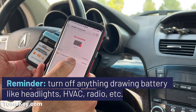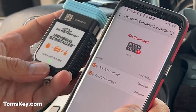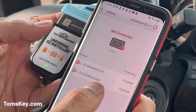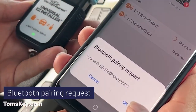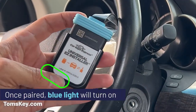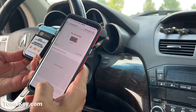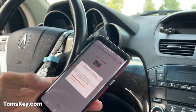Now I need to make a Bluetooth connection — it's trying, we're looking for the blue light to show up. Because I've used this phone on a different EZ installer, you can only use a programmer for a single vehicle because it ties into the VIN number. So I've got to match this serial code — most of the time you should just have one. It's asking if it wants to allow pairing. Paired — this guy turned blue, and we've got a green connected here. It lost the Bluetooth, and it's got to do a firmware update now. We're going to wait a few minutes while this thing does its update.